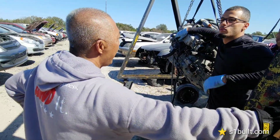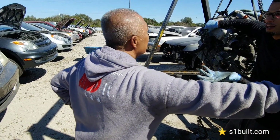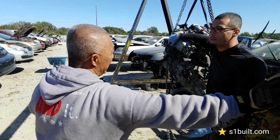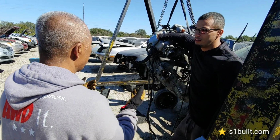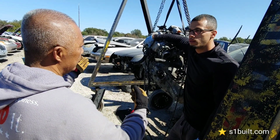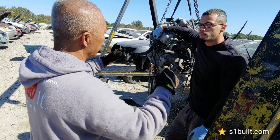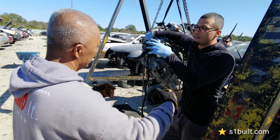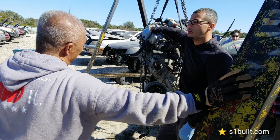I've been seeing that, when I see the CRV, I look at the caliper, it's the same part number as when I had the Type R 5-lug in the front, but I'm like, all right, what do you do with the back if you go all-wheel drive? Even if they want to just do 5-lug, they could buy our arms later on if you want to go all-wheel drive. Just take the stubby out. So you could buy just the rear from you guys to go all-wheel drive, but you don't necessarily have to be all-wheel drive right then and there. Nope. You could just be 5-lug, as long as you get the CRV.